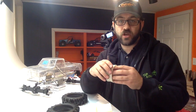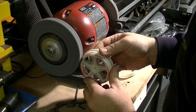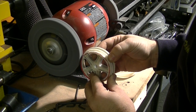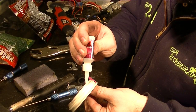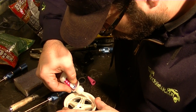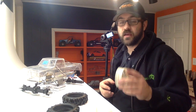My little lathe isn't big enough to actually chuck up one of these wheels with the jaws that I have, so I had to use some other tools around the shop. I came in and ground a groove around the outside of the wheel to allow for the other half to slip over it. I did this in the area on the outside of where the face of the actual wheel is, because of the extra thickness provided there. After gluing these two halves back together, I couldn't be happier — they're rock solid, a really firm setup, and I don't have any concerns about strength on that design. I'm going to narrow the other three wheels for my truck, as well as four more for Squirrel OD's mega truck and four for Howard's truck. It's probably going to be a full night's job just to narrow all the wheels.